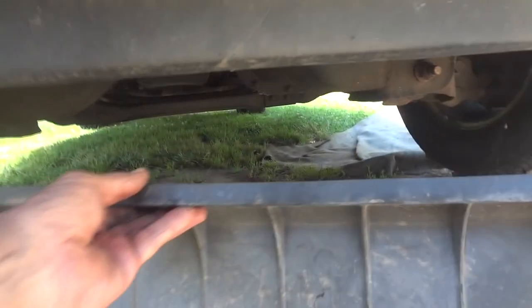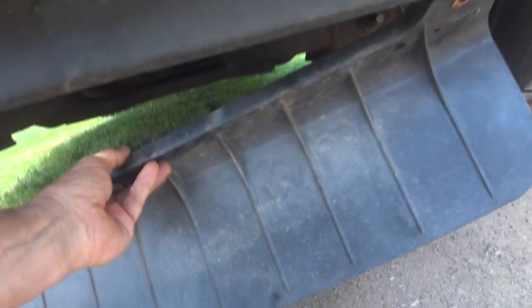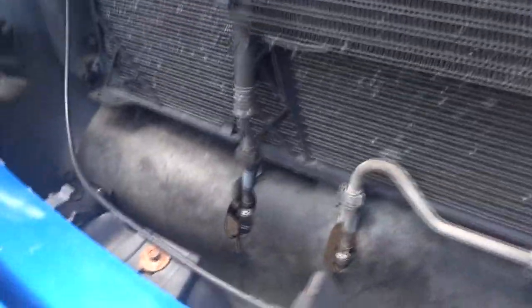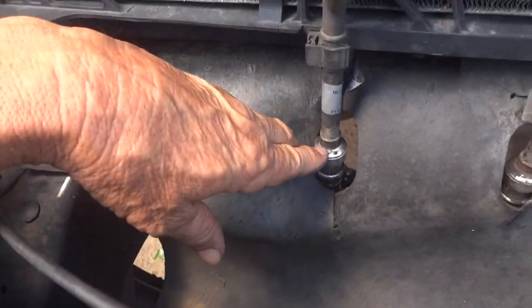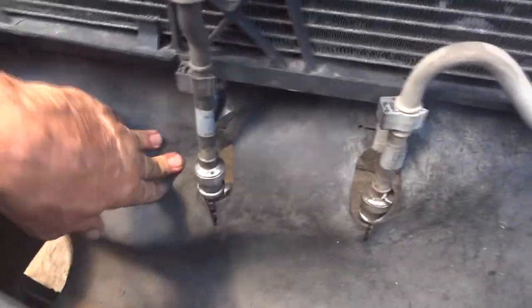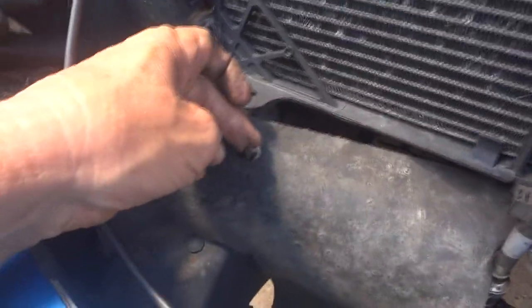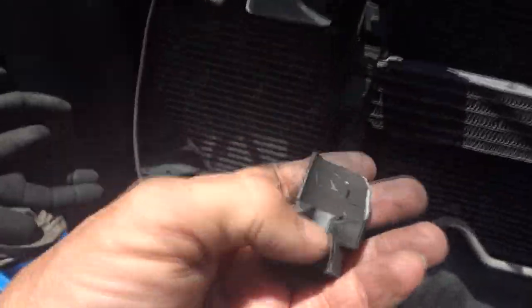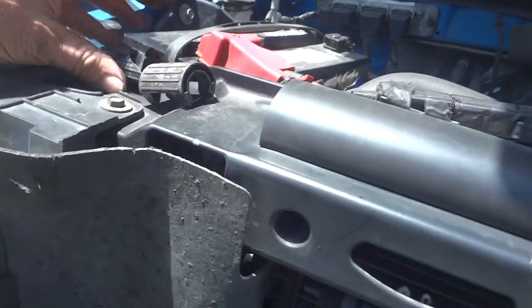There's also this piece of plastic on the bottom that's bolted up under here — it's in a very annoying spot. I would just take it out; it's just two 13 millimeter bolts and you have so much more room to lay and work. Here is where the lines connect. I'm going to try to make a tool to just slide down and pop these lines out. I got one of the clips out but it was a bear. Also, these safety clips here that hold the lines together — I just barely pulled on one and it broke right in half, so I'll have to find another one.